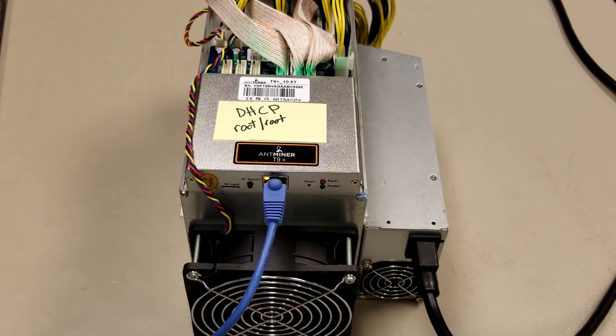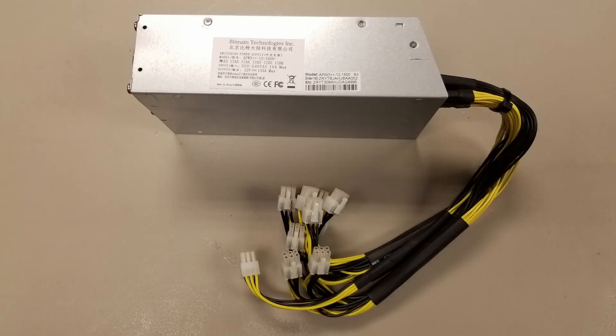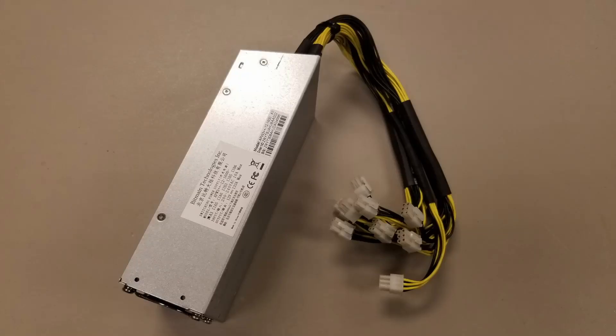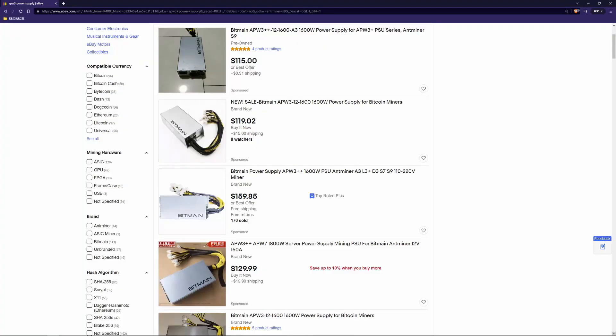As far as ordering ASICs is concerned, there are a few things to keep in mind. Many of the ASICs for sale do not include power supplies. The series of Antminers we are focusing on in this video all have a separate power supply from the main ASIC unit. Be sure when checking on prices to take that into account. Power supplies tend to fail quite a bit more often than the ASIC unit itself, and it's not uncommon for an ASIC to go through multiple power supplies during its lifetime. Power supplies like the APW3, which are commonly used for these Antminers, even used can sell for well over $100 US.